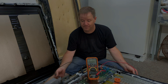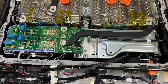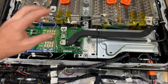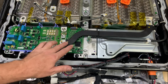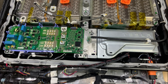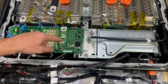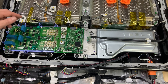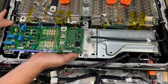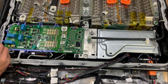After finding out the batteries have zero volts, I won't be removing them from the casing because I'd like to try and revive them on video. I'm going to leave the water cooling in place and leave those batteries in place — stay tuned to see whether they can be revived. We've got positive on this side, negative here. To take off the bus bar, there are four T20 screws and a couple of 10-millimeter nuts at the bottom, plus another 10-millimeter one here. This plate I thought was a reservoir is actually a water cooling plate.